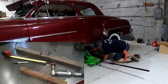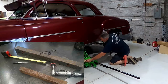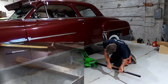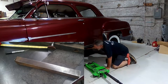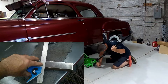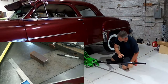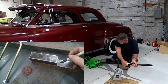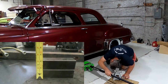I had plenty to cut four sections at five inches to make two stacked pairs. Here's a picture of the tools I used: measuring stick, whiz wheel to clean up the metal, a Sharpie, and safety glasses — safety first. This is the inch-and-a-half stock cleaned and prepped for cutting and welding. I'm using a right angle to get a straight line to mark the cut line, then using the first chunk to mark the cut line on the second chunk.